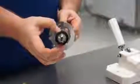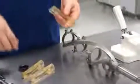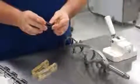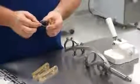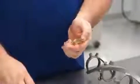Finally, on the back side of the beater is your beater seal. At every cleaning, the beater seal and the blades should be inspected for signs of wear or damage. If the beater seal shows excessive wear or any signs of tear or damage, it should be replaced.